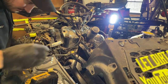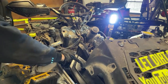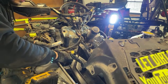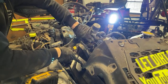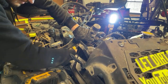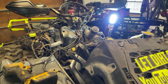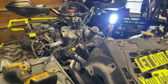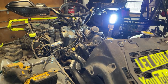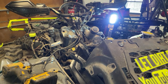All right. Let me get this plugged into the power steering pump real quick here. Actually, I'm just going to hang it down there because I forgot I got to blow everything out. I just got to get this into position. Let me throw the new zip ties in place. Basically how you do it is there's little spots for the zip ties to go, and you want to install the zip tie first and kind of lay the harness in there and then tighten down the zip ties. So move the factory ones here. I gotta find my zip ties wherever they ran off to. Hello, where'd you go? Not sure where the zip ties ran off to, but I need them. I have another bag, but oh, they're there. Right in front of my face.